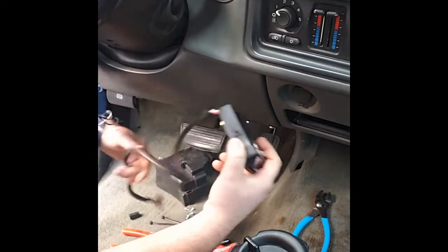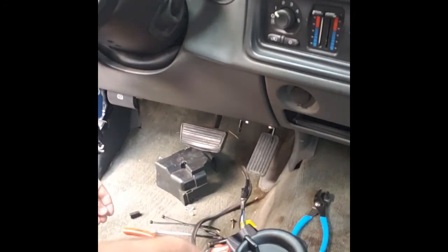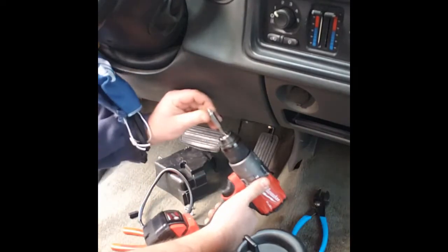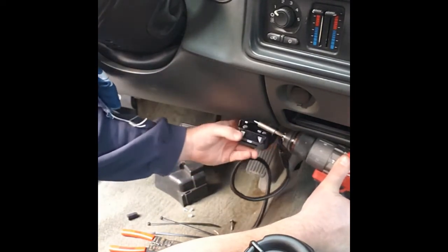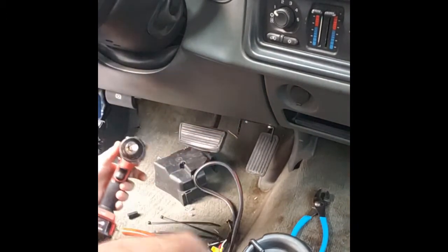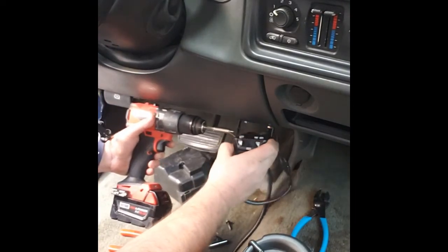So it's actually the same exact screws as we used for that, same diameter and everything. So we'll set those up in the battery drill. And there's 2 different holes on here in regards to where to mount it. So we're going to have to kind of eyeball it here, see what's going to fit the best. I'm probably going to leave it low so that I could use the options on the brake control. So I can flip it down like so.